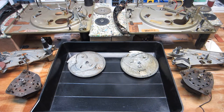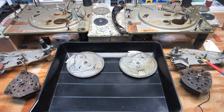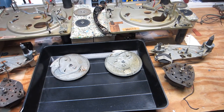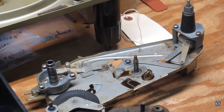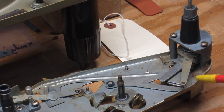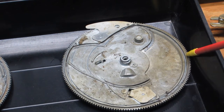And I'll throw in a rubber ducky if I can into the tub here. But before moving forward with that, I am just going to touch on how the main cam is removed from the subplate assembly. It's pretty straightforward, but one thing you need to be aware of — you remember I pointed out this tone arm lever here with the follower pin that rides in the track channel or groove on the cam.